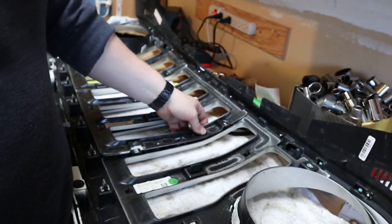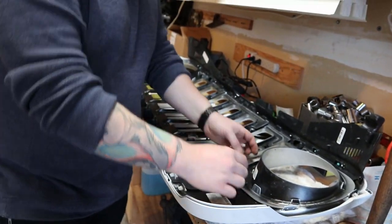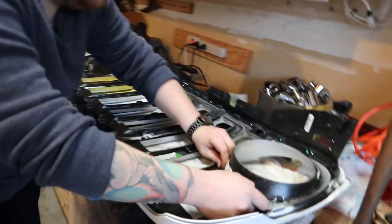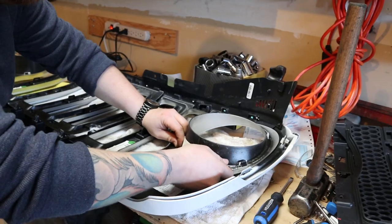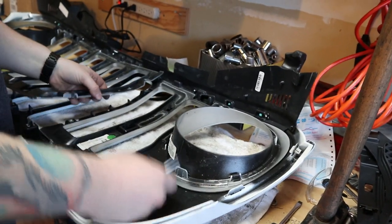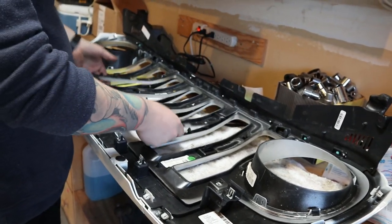These pieces are segmented and they come up and around the headlight bezel. It looks like they have little clips with metal keepers on them, so I'm going to try and slide them off with a flat blade and see if I can get them up and off and take the pieces out. The center one might come out right now — yeah.